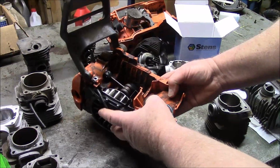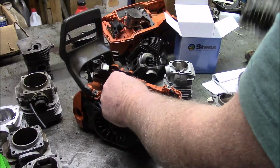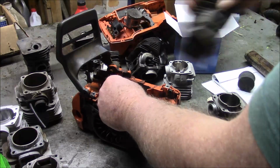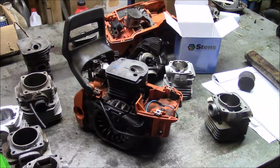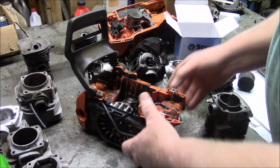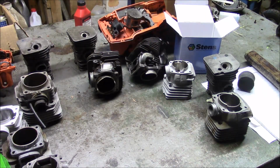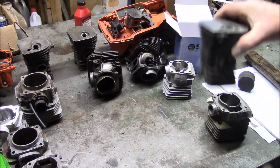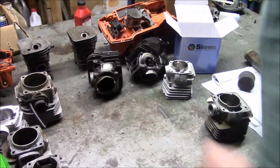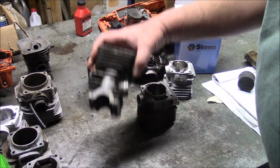Here's the other half of that deal, where you have a one-piece plastic injection molded case where the cylinder would sit right down on top of that, and that makes it really easy to manufacture that saw. You have less pieces and therefore less machining to do. And before anyone dismisses this design, it's worked for a long time. It's actually a very reliable design. There's less junctions that have to seal, less parts. So that's open versus closed. And a clamshell design. What does a clamshell mean? I guess I'm putting more terms in here.